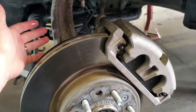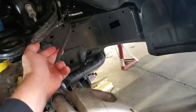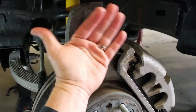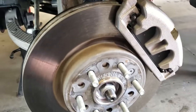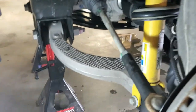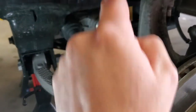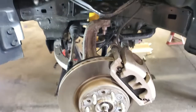And if it falls out, it's going to pull out on the front CV axle. If it goes right or left, we risk damaging not only our brake line, but anything else that's in the way. So if we tie it back through here, that'll keep some torsional stability and then some front and back stability of the front of the knuckle, so we don't lose control of it. And then I think personally what we're going to end up having to do is, once this thing drops out, we're probably going to have to put a little bit of pressure down here and maybe up here just to slide this thing out. But theoretically, it should all slide out as one big piece.